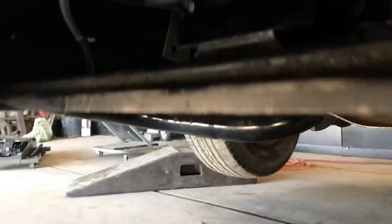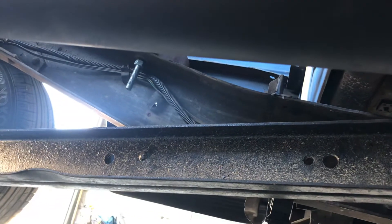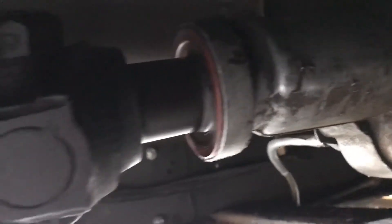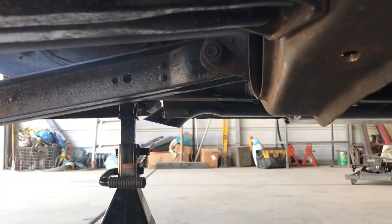I also ended up having to change the transmission mount because the one in here was shot out and the transmission was a little bit off-centered to the left. You can see right there — I had to drill another hole and move it over. I also changed it to a one-piece driveshaft. This driveshaft is from an S10 Blazer 4x4 — it was perfect. Length-wise it was 51 and three-quarters inches, which is exactly what I needed. As you can see, it's sitting nice, with about three inches of yoke inside the transmission. The other one only had about an inch of yoke grabbing on and it was a two-piece — kind of funny looking. I didn't like it.